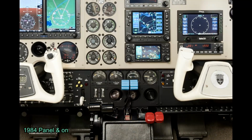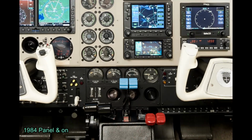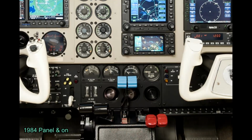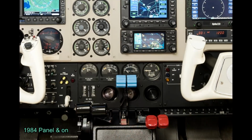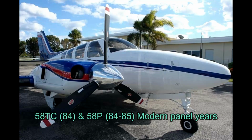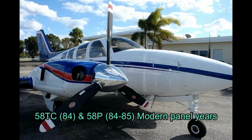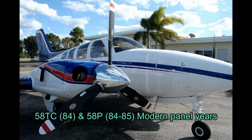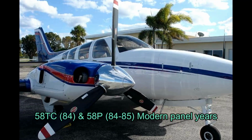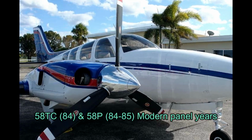They also moved the flap and gear switches to the conventional position. So prior to that, the flap had been on the left, gear on the right. Now they moved it into a standard position. So that is a huge difference. So the 58TC and the 58P were discontinued in '84 on the turbocharged model and '85 on the P model. So if you want one of those that's got that upgraded instrument panel, 84 is the only year for the TC, and then 84 and 85 for the P.